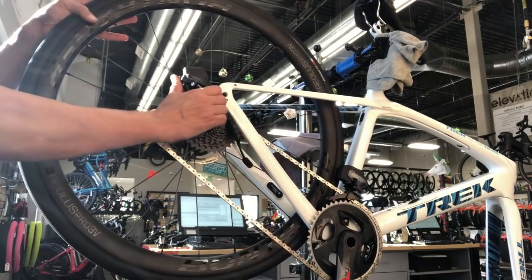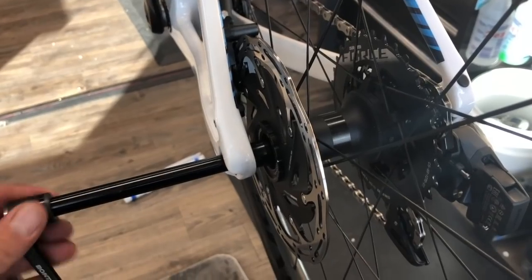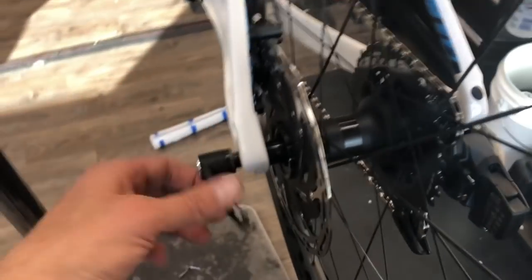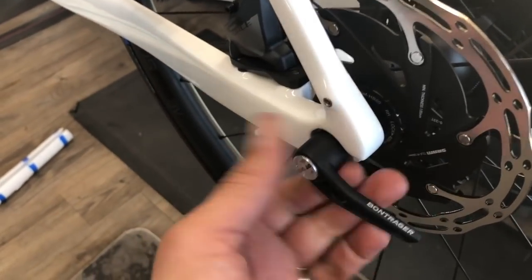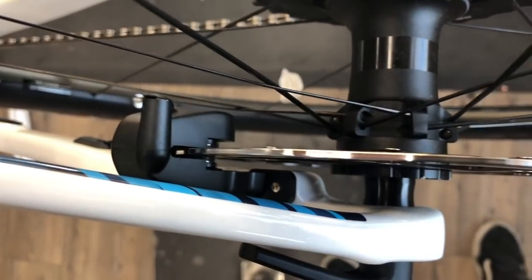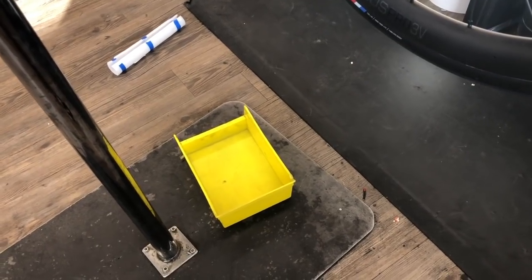Getting the rear wheel in — it's a through axle style, not really much different from a skewer. You slip it in, there are little stops on the dropouts, and then you just thread the axle through. This is a DT axle, basically like a big bolt that runs through. Once you get it where you want, you can position it for maximum torque, then pull the lever out and position it out of the way. The brakes were rubbing a bit — probably should have loosened the caliper first.